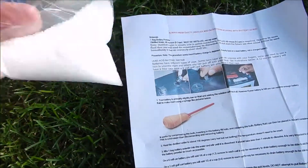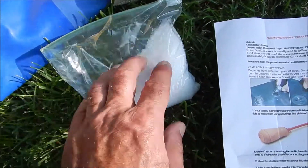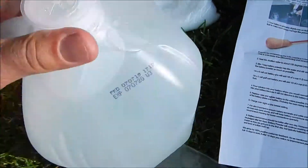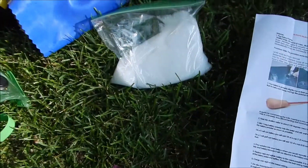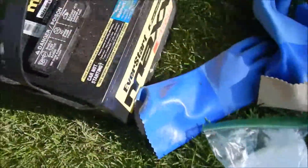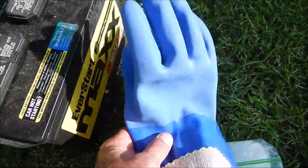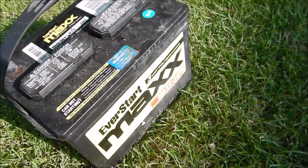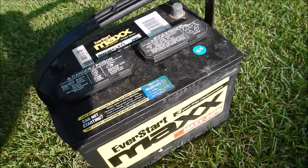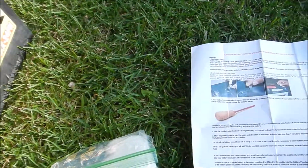They say it has a very short shelf life, so mix only as much as you need with distilled water — and they do say distilled water. First things first: wear your safety glasses. Battery acid is very, very bad for the eyes. Wear chemical gloves or rubber gloves. Battery acid is pretty nasty stuff, and getting it on your clothes — when you put them through the wash you'll notice big holes, especially in cotton.